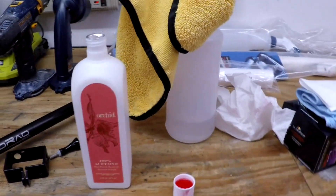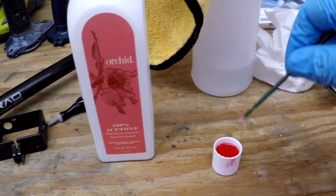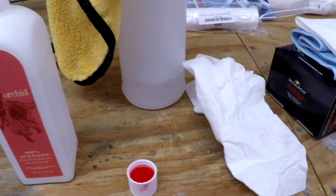Now that the touch-up is done, according to the instructions you're supposed to wait three days before waxing the car. It does say it's immediately okay to be in water and rain. I'm going to go over it with some Showtime just to make sure there are no blemishes or dirt I may have stirred up. To preserve the paintbrush for future use, I took some 100% acetone, poured it into a cap, put the brush in, shook and stirred it around, then dried it on a paper towel — that way the brush won't harden. Again, the product is called Dr. Color Chip. I definitely recommend it — thanks for watching and don't forget to subscribe.